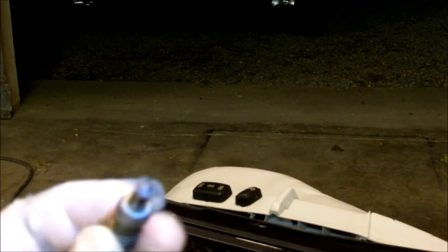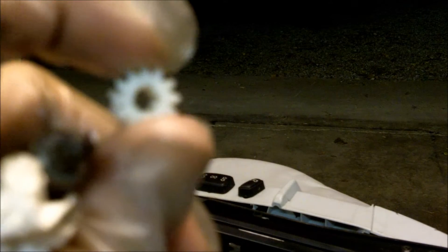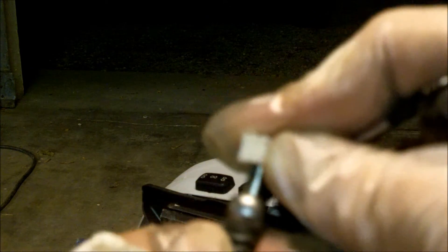After you get your gear off — I just broke it off without pulling the clip off — there's a little C-clip on the tip that's kind of hard to see. I'm just going to use a pair of pliers and pull that off. You can get these gears on eBay, or search for 'E36 seat gears' — it's pretty apparent. One side the hole is bigger, so it's kind of tapered, just like the shaft it's pressed onto.